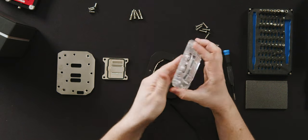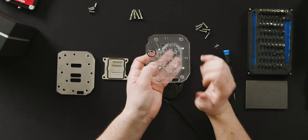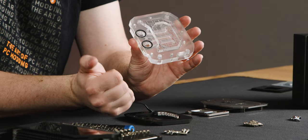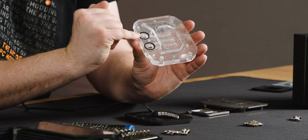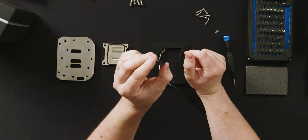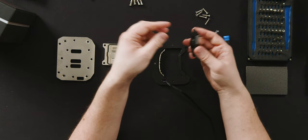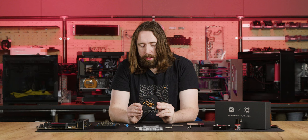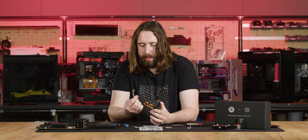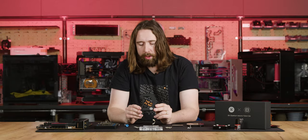The next piece in the assembly is the plexiglass top, which has Ryzen engravings and chiplet details in the same style as the chip itself. It has two additional O-rings on the top side that contact the terminal, so there are no G1/4 inch threads in the plexi but rather in the terminal. The terminal is a small piece of machined acetal clamped by threads through everything. The last component is the aluminium top cover — solid machined aluminium with space for a dense LED strip inside that illuminates the top portion of the plexi, all the coolant, and the engravings.